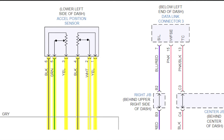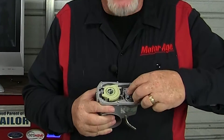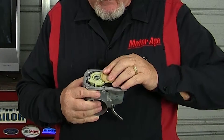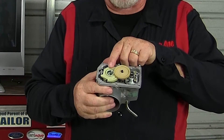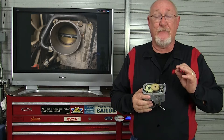The electronic throttle body works hand-in-hand with the accelerator pedal position sensors. As the driver operates the pedal — whether accelerating, decelerating, or maintaining a steady speed — these sensors submit a signal to the ECM. Based on these inputs and other information, the ECM sends out a signal to operate a small DC motor contained in the assembly. Notice the reduction gear set connecting the motor to the throttle plate, giving the ECM precise control — as little as one half of a degree at a time.